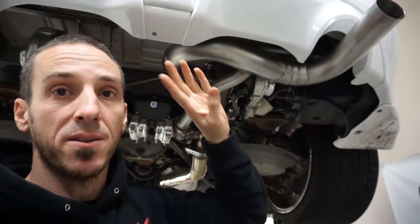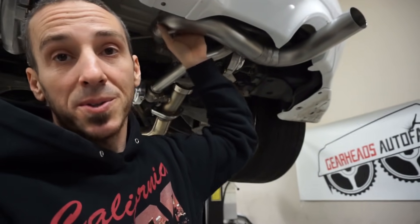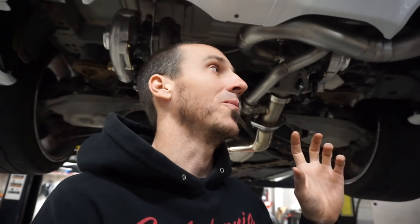It's the next day. This side of the exhaust — the wastegate dump and the full exhaust routing — is completely done. The only thing we decided we wanted to add: turbos sound really good when they just come straight out and dump, everybody likes the sound of the turbo, but I've kind of heard it like that for a lot of years and I wanted to hear it sound a little different. There's not really any room in this section to add a resonator, and then it dawned on me — they make resonated tips. We just went to the local store and found these DC Sport tips at the local O'Reilly. They're the same size diameter, made to be clamped on, still a two-and-a-half inch inlet, and they have the little resonator stuff in there. I think it'll give it a little bit deeper tone. You'll still hear the turbo, but I'm hoping it makes it sound a little bit nicer.